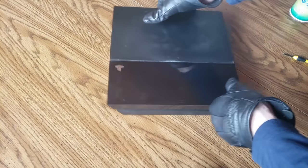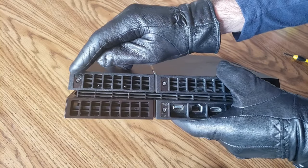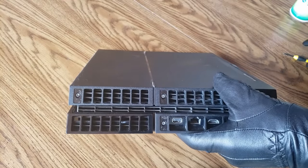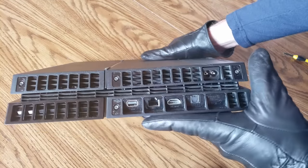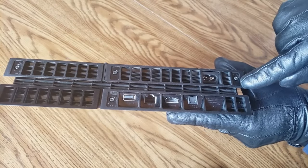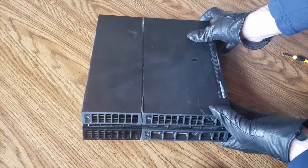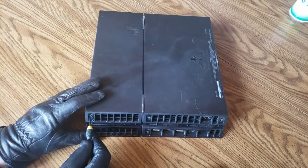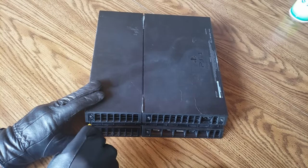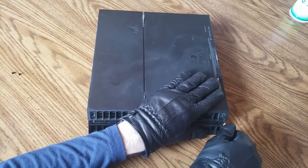Now turn your PlayStation 4 around so you're viewing the back, and completely flip it over so you're viewing the bottom. In my video you can see the screws, however there will be a plastic wrapper over the top of the screws and you will need to peel those off using a knife or the flathead screwdriver. Be very careful not to stab yourself. The 3 screws I just pointed out will need to be removed to take off the cover — so grab your TR9 security screwdriver or your 2mm flathead. These small black screws are a little bit hard to find if they fall into the carpet, so just place them off to the side in a good location.